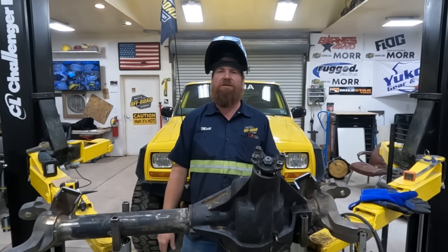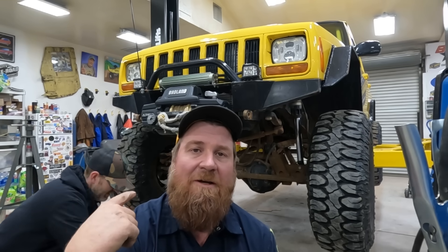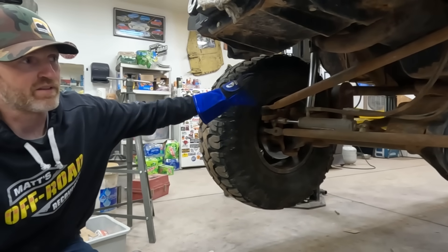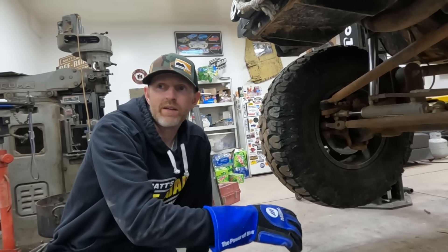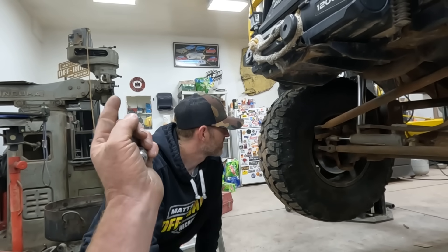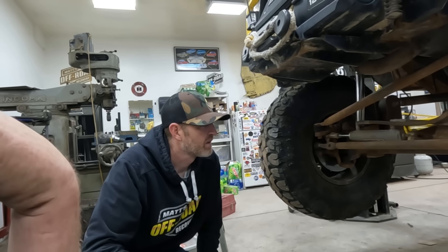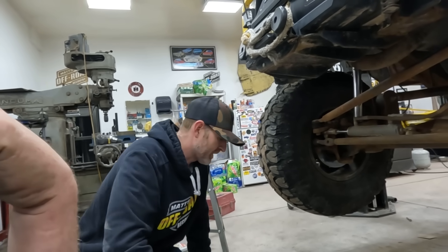I think we need to just take this off of here, get the Banana on the lift. This time you had sound effects — last time it was all miming. Okay, we got the Banana up in the air. We're going to start taking it apart, get the front axle out. We've got to disconnect the brake calipers, get the hydraulic ram off and zip-tie everything to the body, then undo the links and the bottom of the ORIs and we're done.